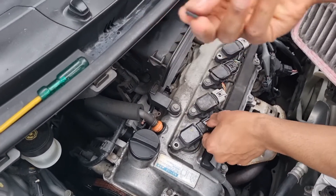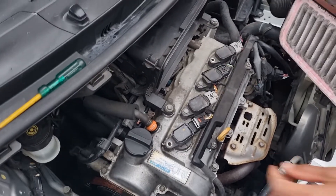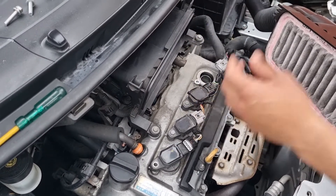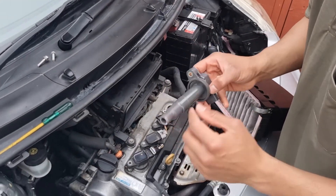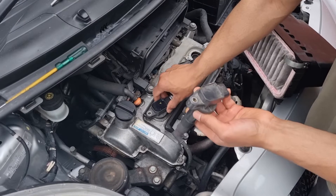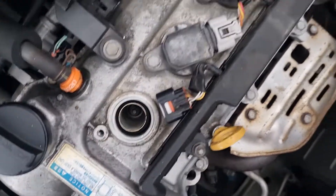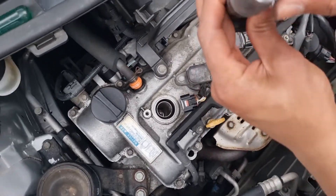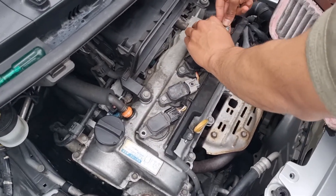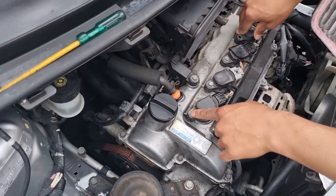These plugs are brittle — as you can see it breaks because of the heat, and just over time you can get that replaced or cable taped. Preferably do this when it's a little bit warm as the coils will come out easier. Inspect the coil — check for any oil around here. This one already has a yellow mark so we know where to track it. Sometimes you get oil in there if your rocker cover is playing up. In this instance it's all fine, no corrosion.